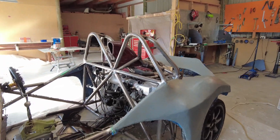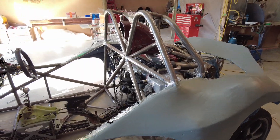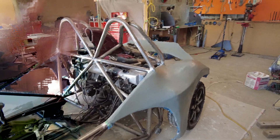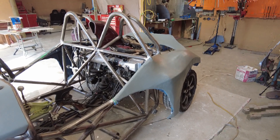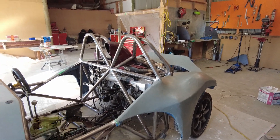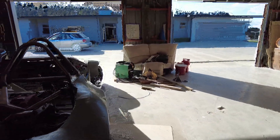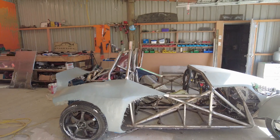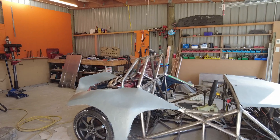The front I've got very similar to the other side. The fiberglass is actually going to hook over this edge here, and its attachment points are going to be back in there, so I can just plonk these things on and they hook over the top. We'll see how that goes - if it doesn't work I'll cut it and add some tabs, but I'd prefer not to have fixings obviously visible. I'm going to have to cover up the body so I don't get fiberglass everywhere. I can't really pick these things off and on - I kind of have to fiberglass them on there. Now I'm going to do all the waxing and PVA release first to help release the mold in future.